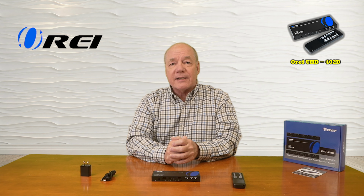The product fully supports 4K ultra-high definition media content and is both HDMI 2.0 as well as HDCP 2.2 compliant, which means it's plug-and-play compatible with all of your modern media equipment. The product also provides full support for ARC audio, so you can easily use it with newer soundbars or stereo equipment that adheres to that standard. It also provides audio extraction capabilities where it can digitally separate the audio component from any HDMI media stream and then allow you to pass that audio along through an analog or digital connection to a soundbar or home stereo for that full theater experience.